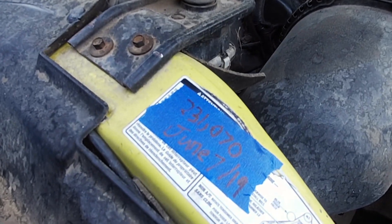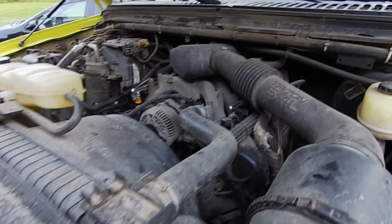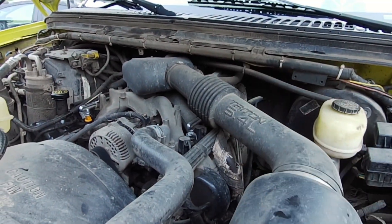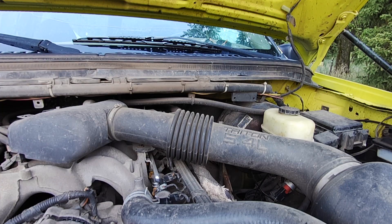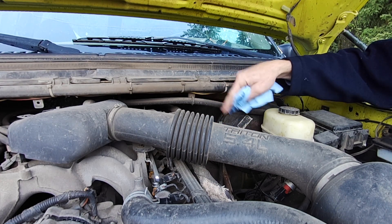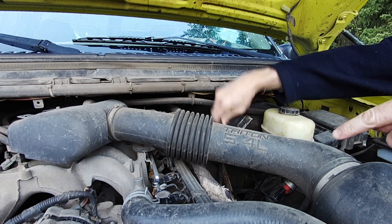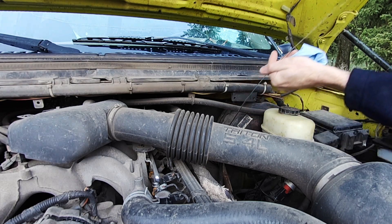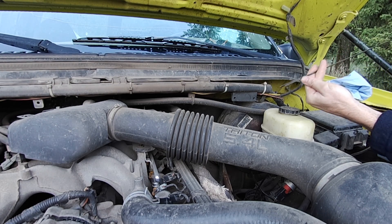I went ahead and made a little tag to show the current mileage and date when I changed the oil. All I've got to do after I shut it off is confirm the oil level after the oil drains back down. Just give it a few minutes after you shut it off before you check the oil. It's been about 10 minutes since I parked the truck, so we're just going to dip the oil. Make sure you clean off your dipstick handle before you pull it out — you don't want to be dropping contaminants in the engine. It looks like it's right about on the top of the cross-hatch, so I got her bang on.